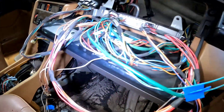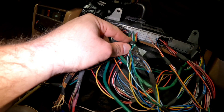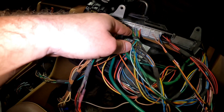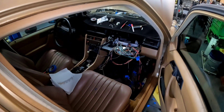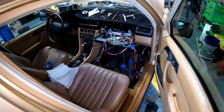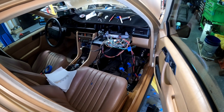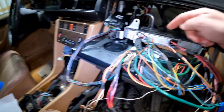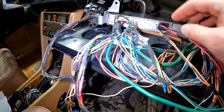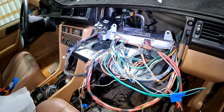The stock GTE cars had accelerator pedal sensors that communicated with the TPS. I'm not running that electric pedal, so I basically took the accelerator pedal signals and spliced them into the TPS sensor — all they did was let the ECU make sure the throttle pedal, TPS, and engine were matched. I basically tricked the ECU into thinking there's a throttle pedal sensor when there's not. I also wired one of the F59 plug wires as the drive position switch for the automatic, so the ECU will think the car is in drive and let me rev to redline.